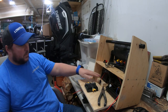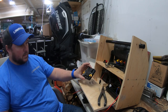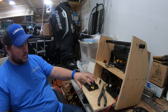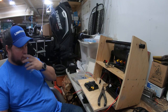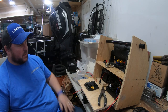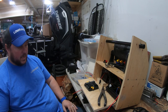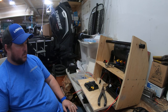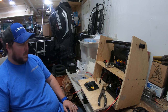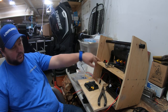What I want to do is I have a lithium 18 amp hour battery — I'm going to feed that to a fuse box. I'm going to run my Active Target out of a fuse, the HDS Live out of a fuse, and I have four more fuses if I want to add anything. I'm thinking about adding an auxiliary port so that if I'm out on the ice and this battery dies, I can just slip in an auxiliary battery and have an extra wire lead to feed these two posts into the fuse bank.